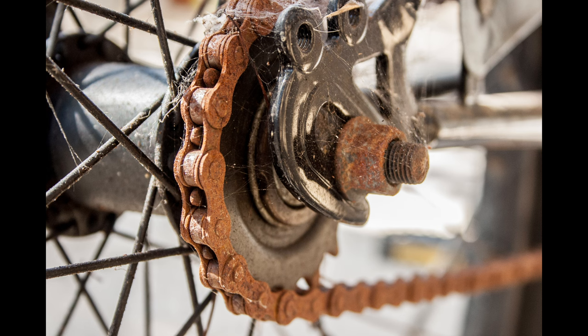Next up, check your chain for any rust. If your chain or chain ring has gotten rusted while in storage, this can affect your trike's riding ability, if not make it unable to ride at all. Rust can fuse your chain links together so they don't bend like they should. Even if they still rotate like normal, rust can make your chain more brittle and prone to breakage.